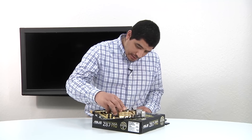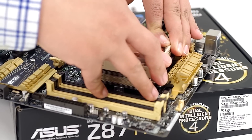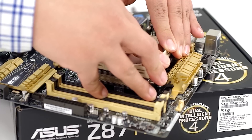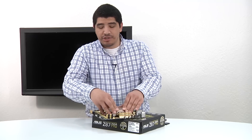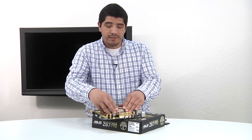We're going to go ahead and set the heat sink down here and depress it, keeping it torqued down for about 10 seconds or so. Of course, the longer the better — you'll get more even dispersion. This is for those of you who really want to check and verify to get a sense of how much has been applied.